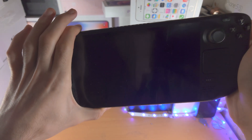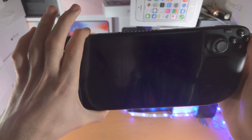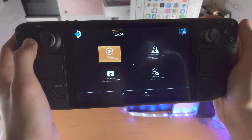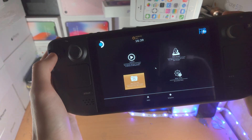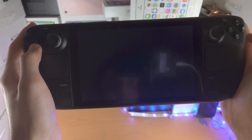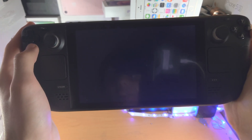You're going to long press the plus key, and while holding down the plus key, you're going to click the power button. Once you've done this, keep holding the volume up key — do not release — and 99% chance you are now brought to this screen. You're going to use the D-pad to navigate and the A button to select. We just want to click on the continue button here, and then your Steam Deck should now be booting up without any issues.